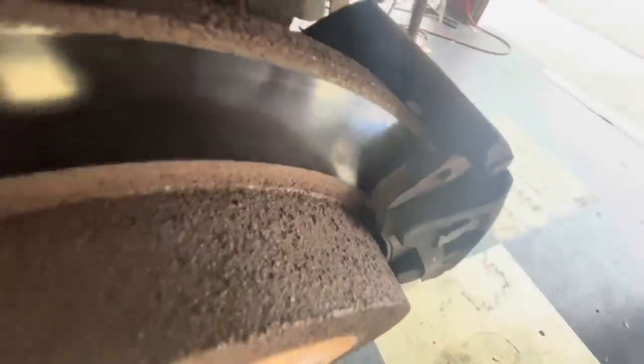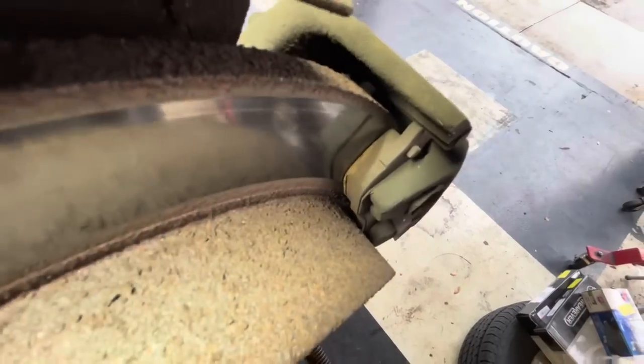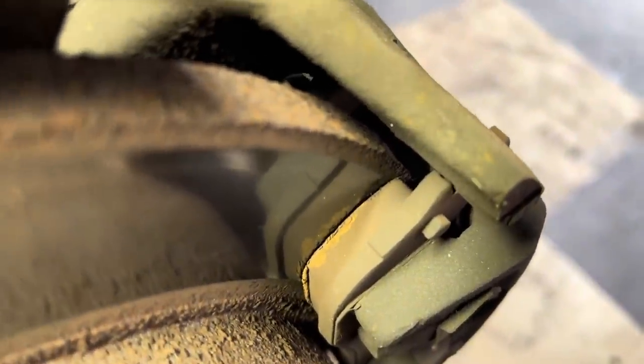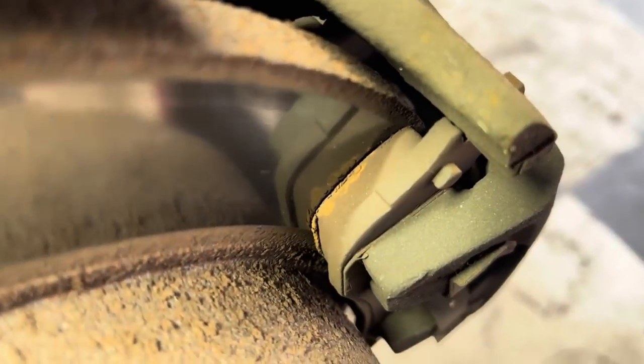Grinding brakes on the Expedition. What I found is that the rear brakes are in excellent condition — we're looking at about 8mm rear pad thickness right here. There might be a little bit of noise because the pad is encroaching on that rusted area on the rotor. That's potentially a noisemaker, but our concern is more of a grinding and brake sticking situation rather than an intermittent noise.